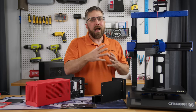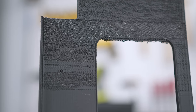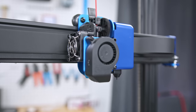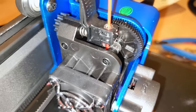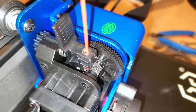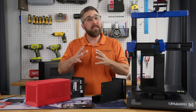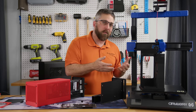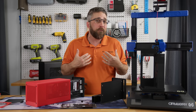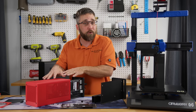But then, with about 80 hours of printing, I started to experience serious under-extrusion. I tried troubleshooting — cleaning the hot end, replacing the nozzle, checking all my settings. That crunching noise is the extruder gear gnawing at the filament. The flat extruder pulley that applies tension against the filament so the feed gear can feed it is binding up. This might be a straightforward fix, but it means taking the printer offline, disassembling, and troubleshooting the whole printhead assembly. It's only a bit of an inconvenience for me, but it means I can't showcase the sleeker, feature-packed version 1.2 of the enclosure today as I had planned.